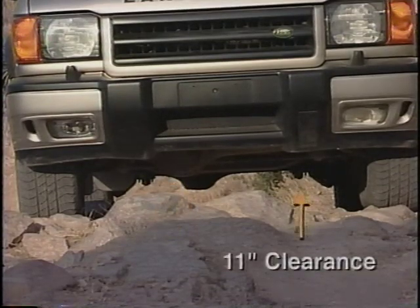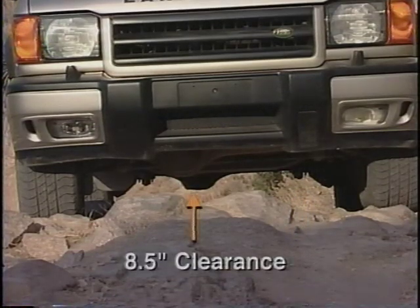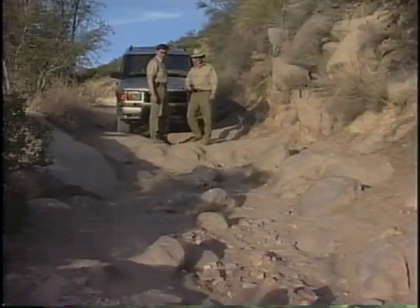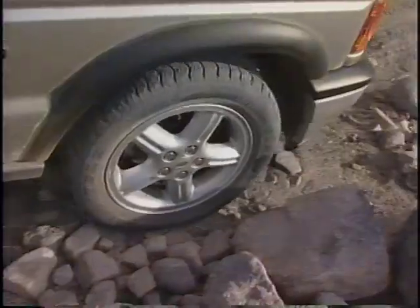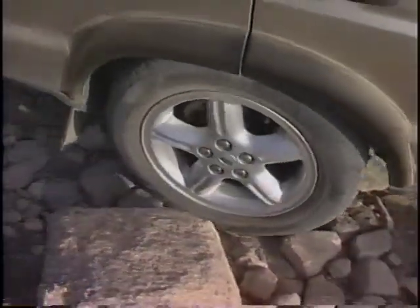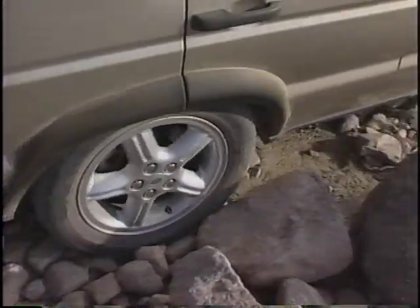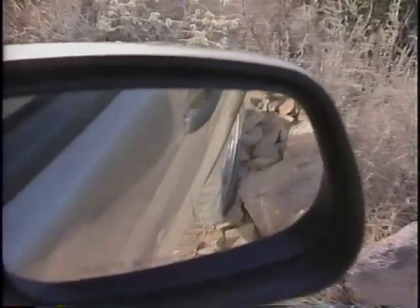This creates the widest possible area with about 11 inches of clearance from ground to undercarriage on the driver's side. Minimum available clearance is about eight and a half inches beneath the differentials on the passenger side. Decide the path to drive — there are several options to consider for crossing each obstacle. If possible, drive around it. Keep in mind that the side walls, both inside and out, are the most vulnerable parts of the tire. As they pass by, try to avoid rubbing, scuffing, and pinching. Your side mirrors will help.